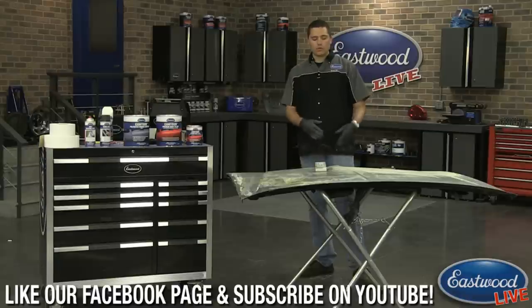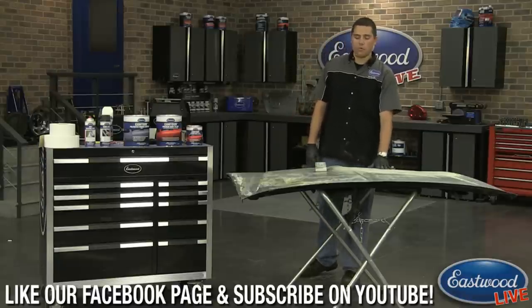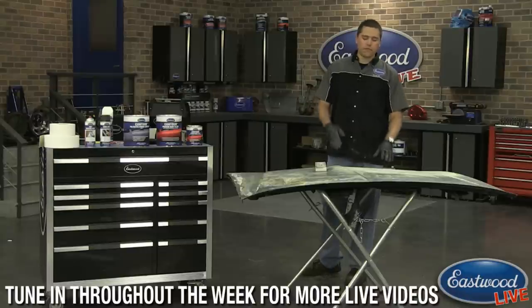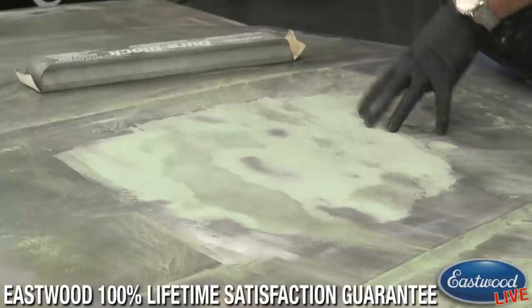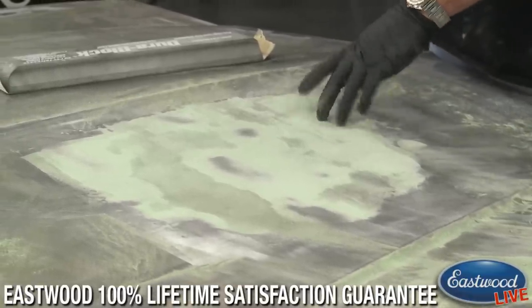A little coarser has more to bite to, especially since with body filler you're probably going to be building a little bit more than you would with a glazing putty. And while I'm on that note, I'll just quickly throw this in here. A question I get a lot is, how thick can I make body filler? Generally speaking, a sanded depth should be no more than a quarter inch, which is a lot more than you think. You might see this and go, wow, you look like you're really thick. It's really not.